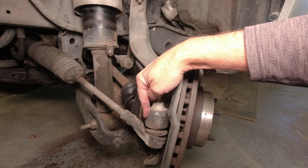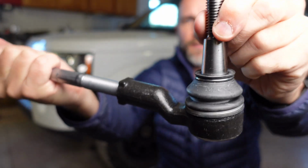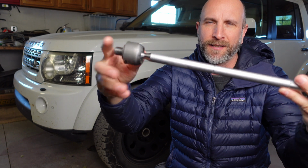What happens is if these joints wear out, instead of being stiff and in control, they just wobble, and you'll get a front end wheel wobble. When I replaced the outer tie rod, I did that really quickly, sort of last minute. Didn't have the time to do the inner, and so I suspect that my inner tie rod, this part right here, on both sides, is bad.